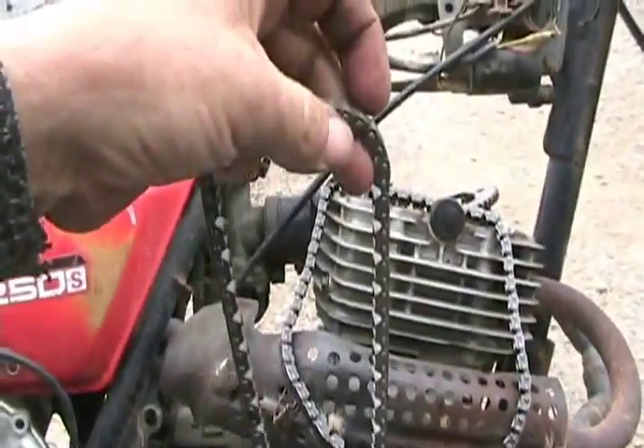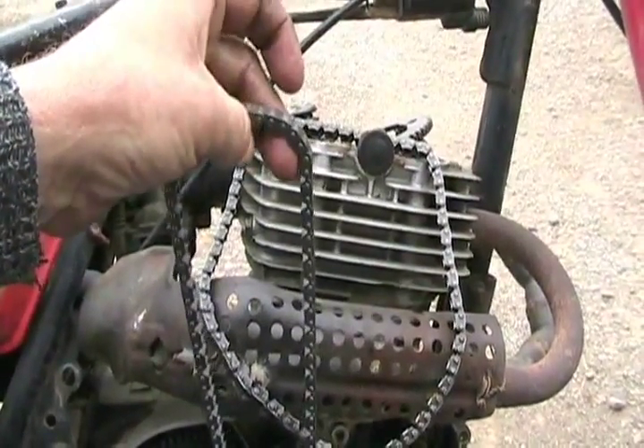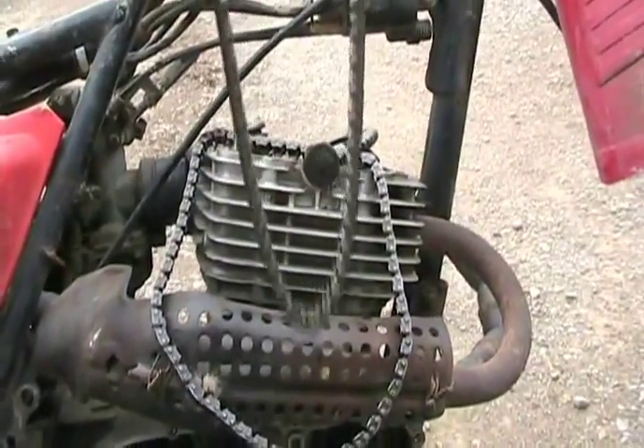You don't have to tie a wire to this one. All you do is, once you knock the pin out of both chains and don't drop it down inside your engine, use a piece of wire and tie the two broken chains together.